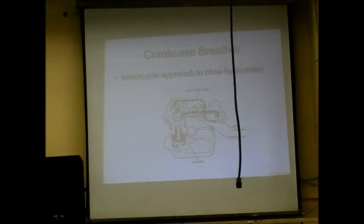Because it's not as precise, our motorcycle idles run a little bit higher to account for that. An automobile may be idling at 650–700 RPM; we're running at 1,100 RPM — double, compensating for the blow-by gases being fed right back into the engine.